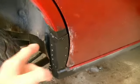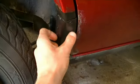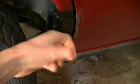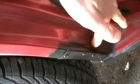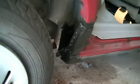What I did was it was rusting out here, so I cut out the bad section and I got some metal here that I just kind of riveted in there. It actually came out pretty good. I'm going to put some body filler around this today. As you can see, it finished up pretty good. This black stuff here is rust corrosion prevention. I thought that came out pretty good, and I also treated down in there.